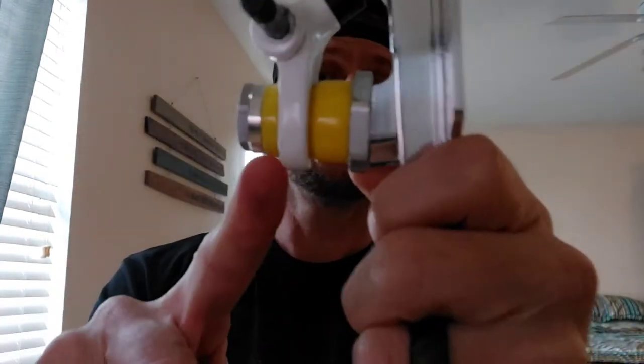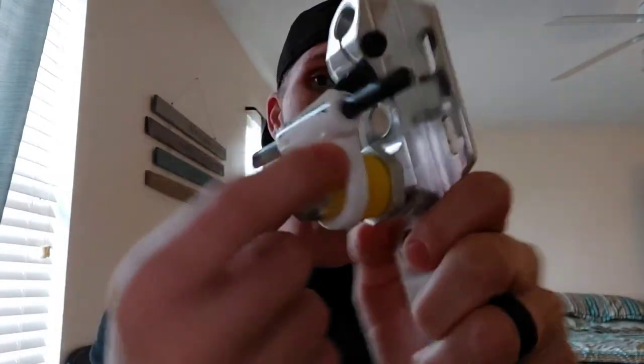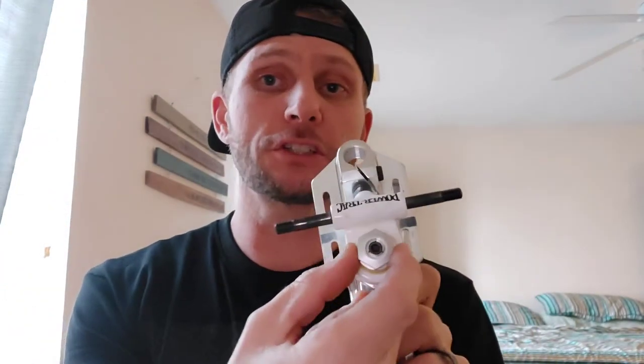In addition to having two different heights of cushions, the diameters are actually smaller on these. The top cushion diameter is actually smaller than the bottom cushion, so the action gets choked up a little faster — it ramps up faster — but that also means at high speeds it's a lot more stable.